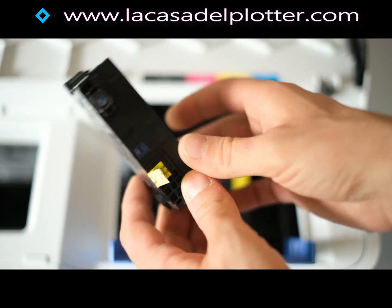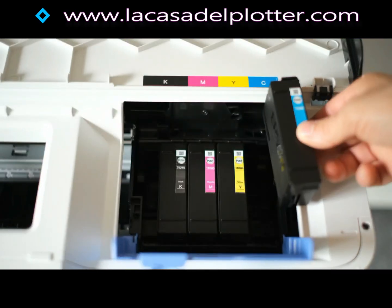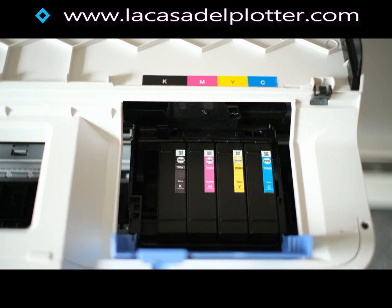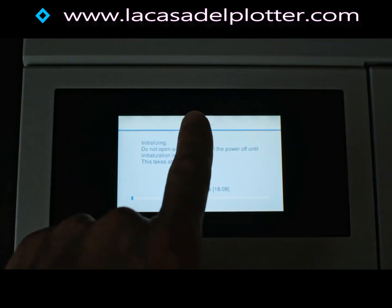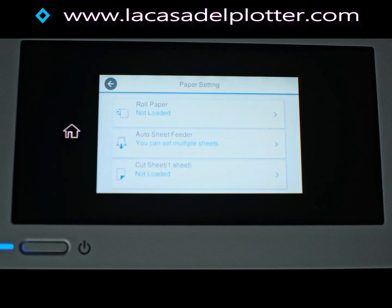Also, it might take a little bit of pressure to make sure that the cartridges are all the way in. Do this gently, but at the same time, you don't want to press too hard so that you damage the printer. Once that's done, we can flip down that blue lid, lock it in, and then close the main cover. At that point, the printer will begin to initialize the system, charging the ink lines. That might take a little bit, but once that's done, you're ready to print.